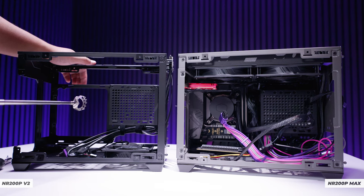Now, what's happening here is when all the panels are off, there's no pressure in the case. So the fans underneath the GPU aren't generating pressure. When we close it up and with the filter off, there's even more pressure for some reason. And we get the best GPU thermals when there's no filter and the side panel is on. So yeah, pretty interesting results here for thermals.